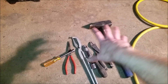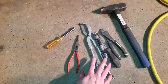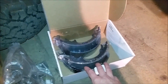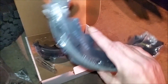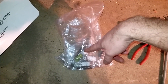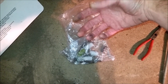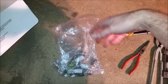I'll finish that side off camera and I'll show you guys what to do on this side, step by step, with as little pissing around as I can. For the most part, this is kind of all you're going to need: a good pair of needle-nose pliers — this is about the bare minimum. One of these spring tools — I never used one before this job, but this is actually turning out to be kind of handy. You of course need the old trusty BFH. We've got some pseudo OEM quality brake shoes here, and I picked up a full spring kit at the old Napa. You want to get one of these when you do your brake shoes.